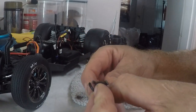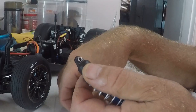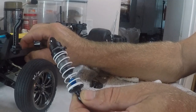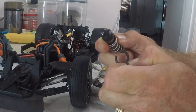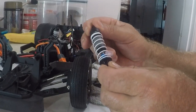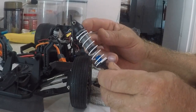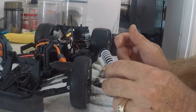Now I want to show you — they come with these little C-spacers to clip over the shocks, and those go on right here and they do take the play out. But by taking the play out this way, you're also increasing the spring tension, which will raise your chassis up — and you don't want to raise the chassis up. You just want to take the play out. So instead of making the springs tighter and raising the chassis, you put these dampers on the inside. Look — all the play is gone, and you still have plenty of shock movement. It took about six minutes tops. I suggest you go on eBay and buy this kit — it's a lot simpler and cheaper than trying to replace your shocks. Thanks for watching.